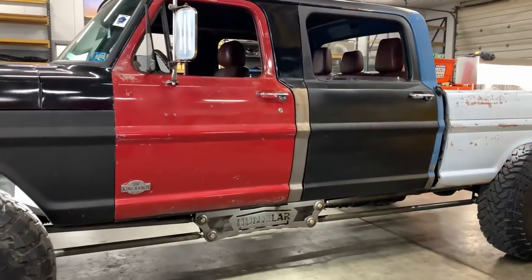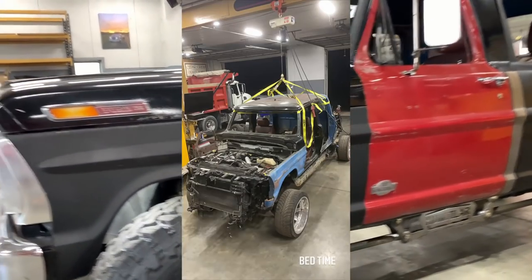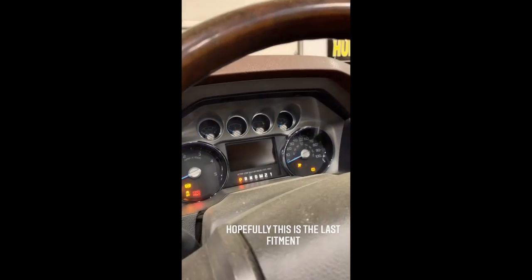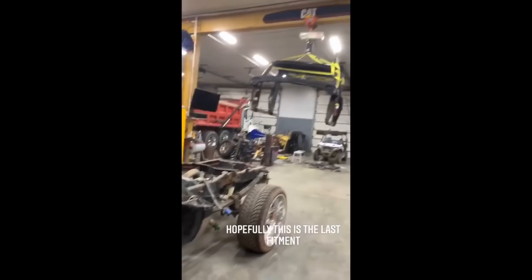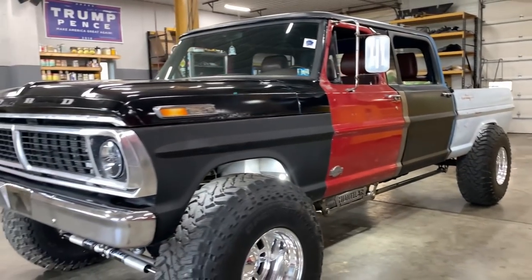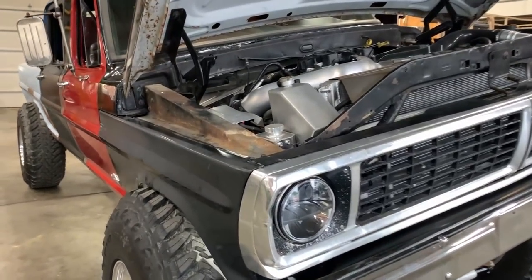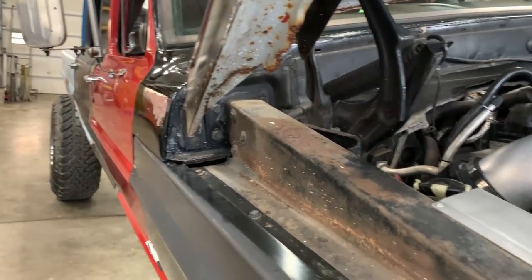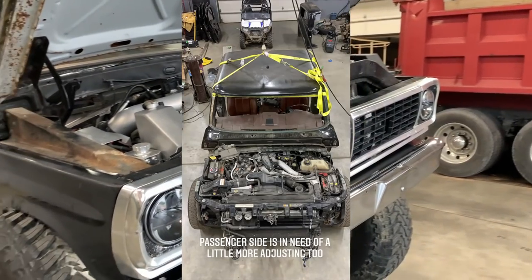After I got those two tacked together, I sat the '68 over top of the 2014 for the final fitment, tacked everything up, and then sat the front end of the '68 on. I left the inner fender of the '68 so that it bolts directly to the '68 firewall and bolted the whole front end to it to get everything to fit.